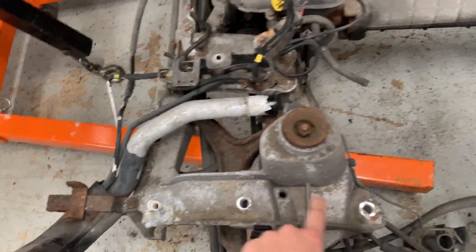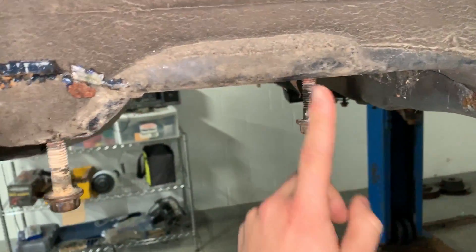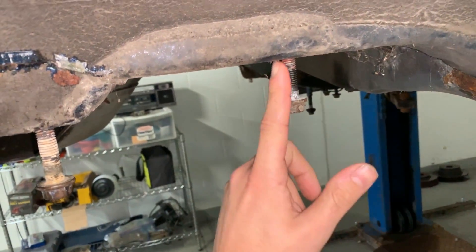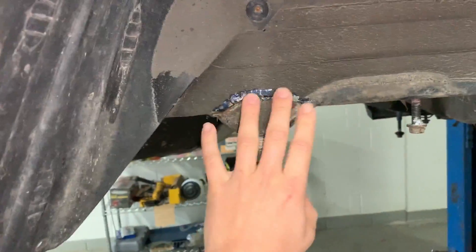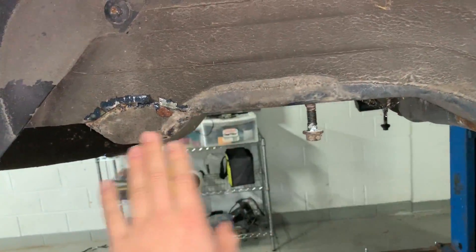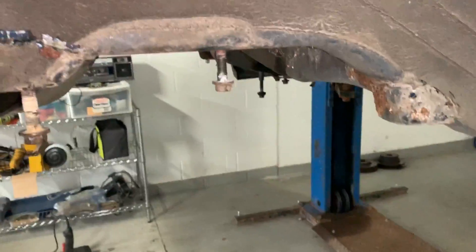You can see we got these three bolt points right here. The 850 and the all-wheel drive stuff actually share this middle bolt point — this is where the front wheel drive spring perch goes — and these two need to be welded on. You have an option to either cut these brackets off, make a jig to align it to this bolt point for each of them, cut these off and weld them on, or create your own brackets.